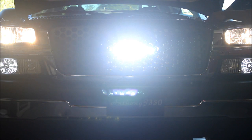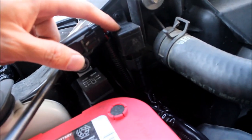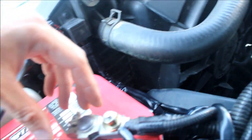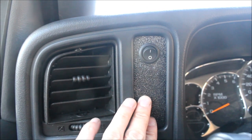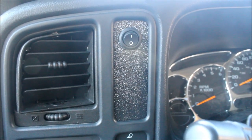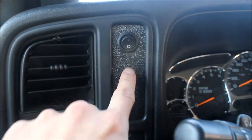It's looking good. So we're done wiring under the hood. We've got our Bosch relay here — it comes with a different style, but I had an extra Bosch relay so I decided to use that, and I've screwed it into the rad support. These Rigid Industries lights are really easy to wire up — it already comes with ring terminals, so you just go into the negative and positive of your battery. It has a fuse and everything too. Then you run it along preferably a bit of factory wiring and through your firewall. For the switch, I've put it in the dash where the push button selector for the four-wheel drive usually goes. This truck's a two-wheel drive, so I've gone ahead and made a panel of ABS plastic and mounted my switch in there. That gives me the option to add more switches as I go along.